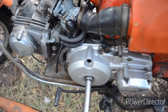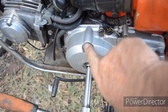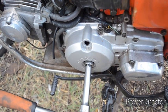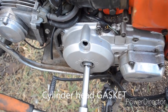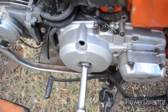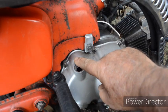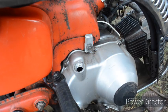On this side we can hear a slight hissing coming from the inspection port. So we've got air getting down into the crankcase. It could be the cylinder head leaking down through the cam chain tunnel, but I don't think so. There's a fair chance it's the piston, the rings and the cylinder. Take out the dipstick and you can hear it — you can even feel air coming out there. So Barney needs a rebore, piston, rings, something like that.